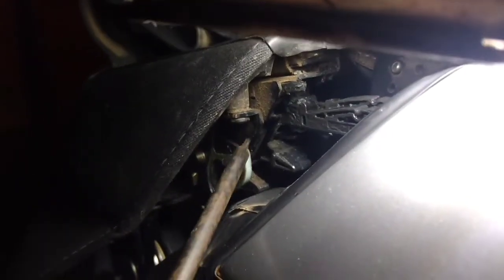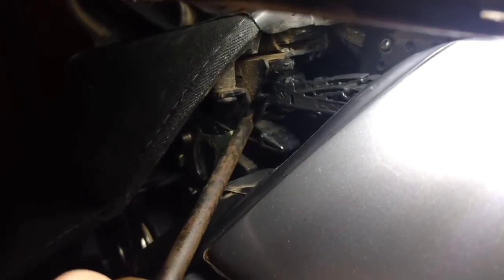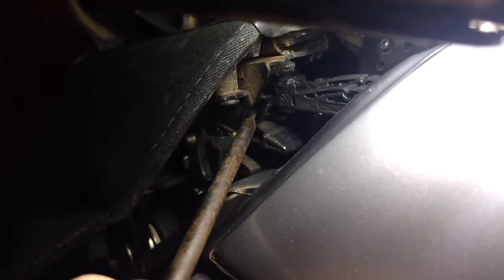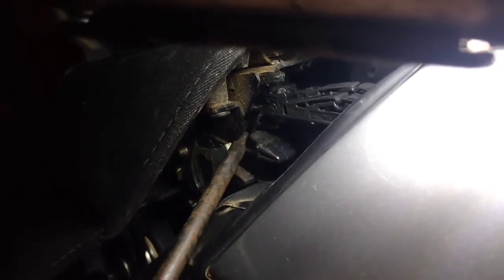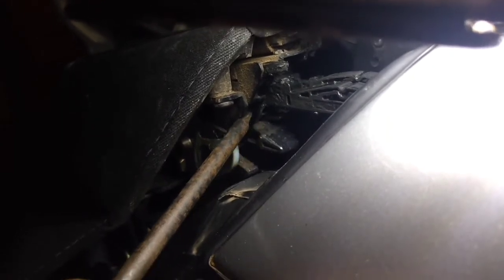The area where the little cable would be is right there — this piece right in there. I think what happened is the cable got pulled in, and now when it's trying to close — which it won't — when you press the close button, this little piece of plastic where the cable's attached to is bumping up against right here, and the cable won't come out to go into the tracks. Right there, it kind of looks like a backward 'C', and that's what pulls the soft top closed.